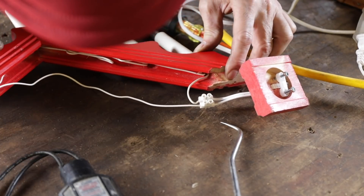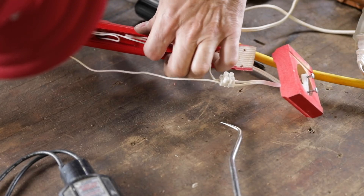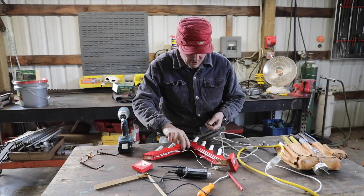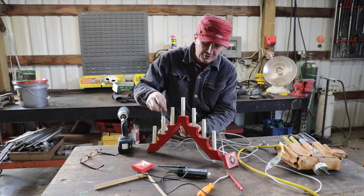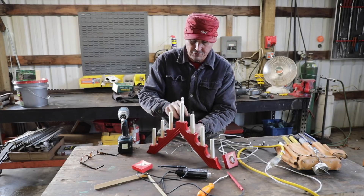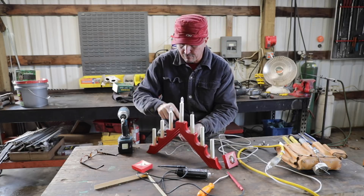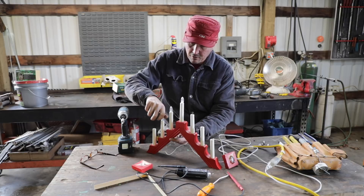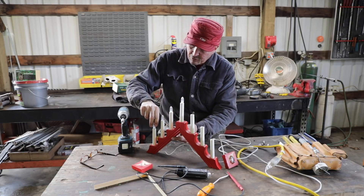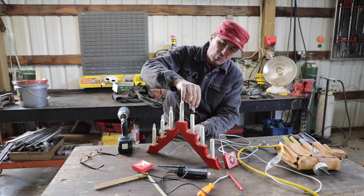It appears to have a race and a cover — let's take these keepers off. Now would be a good time to click the thumbs up if you enjoy watching these videos — comments are always welcome. The cord comes in here and is covered by this little piece of plastic. We've got another place we can test, so let's double-check the switch here. Yes, we have power here as well — that verifies the switch is good. We have wires running up to each individual socket. Before going deeper, let's check the most obvious things: the bulbs.